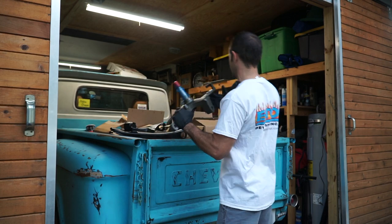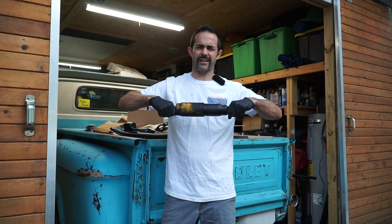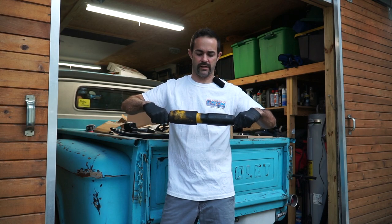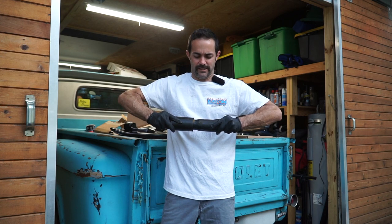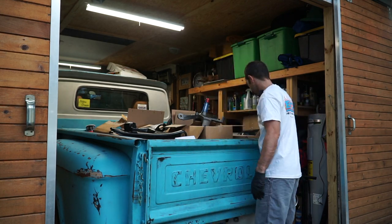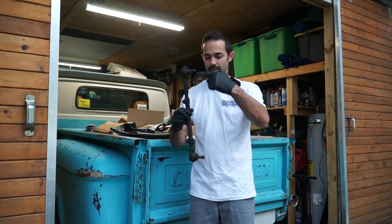While we're in there, there's all kinds of things needing attention on this vehicle. The shocks — shocks aren't supposed to stay compressed like that; I actually have to pull this one apart. It's like a Stretch Armstrong. So if your shock is staying in place, it's time to replace those. Take a look at that tie rod — that thing is nasty. We're throwing on some new tie rods. Keep the old ones so you know the measurements when you go to the alignment shop.